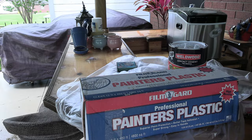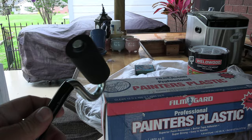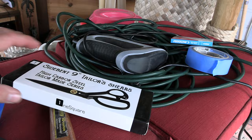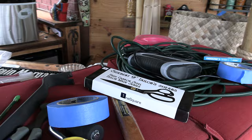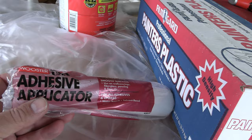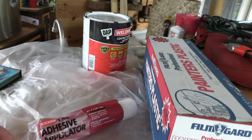A couple of tools I've got: a very heavy roller here — this is what I'm actually going to be sticking it to the ceiling with once I get it all mated up. I've also got an electric stapler, fabric shears, and some tape. When you cut this stuff down, you want double-sided tape on both sides — that'll keep your matting from fraying. But what I really like is that power cutter right there — that will cut it right up and precisely. And then I've also got an adhesive roller. I'll pour some of that out into a tray and roll the matting and roll the ceiling and wait 20 minutes.